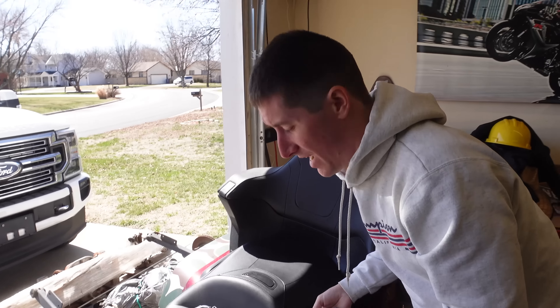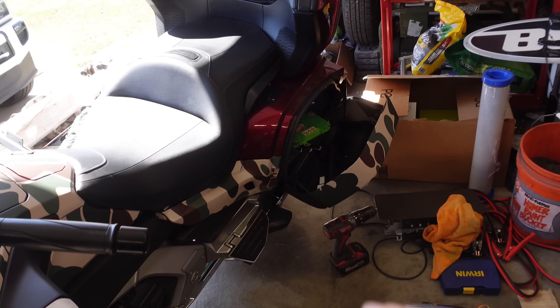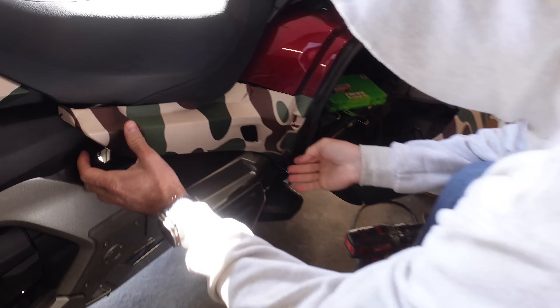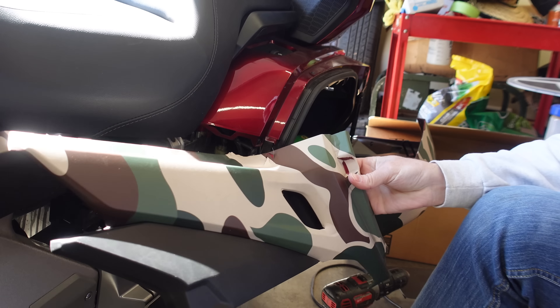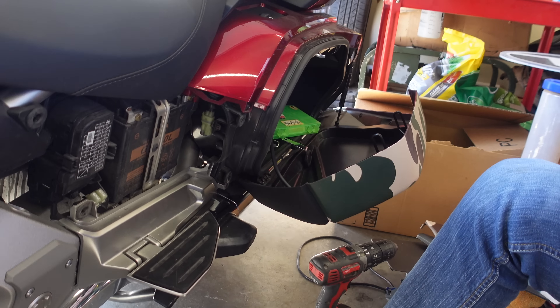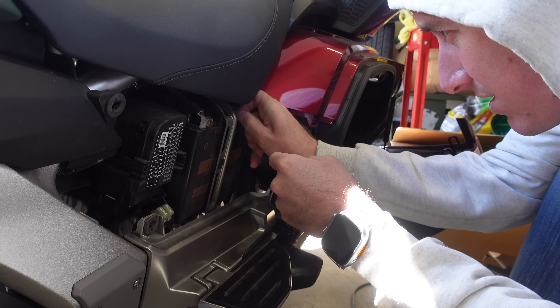I hope your battery never dies — this bike is very unhappy if its battery ever dies. Now we'll shut this thing down, pull this cover off, and get this battery out. A pretty good reason to install a permanently attached bolt-on charger, because then it gives you jump terminals too. If it's on a battery tender it stays good and the battery lasts a lot longer. You could actually jump through your battery tender wires. So you just pull to get this cover off and now we can finally see our battery.